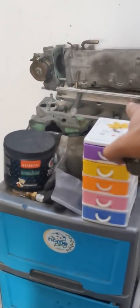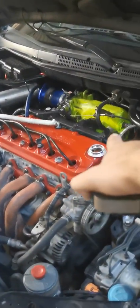We got the customized intake. That's no more stock, like a lot of people run turbo with that stock. I can't believe it. This is directly a big old hole inside of there. I cut all the cylinder walls. All these walls you see here, guys. Sorry, I dropped a piece of the intake to show you guys. Y'all see those walls right there, all these cylinders and that EGR valve wall right down there? Well, all that's cut off, deleted. It's a big old hole going down, like a skunk tube.